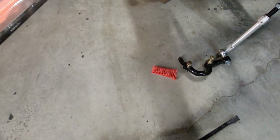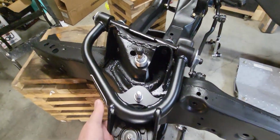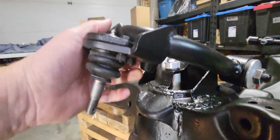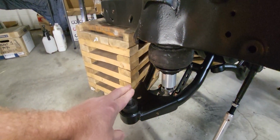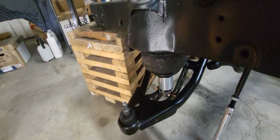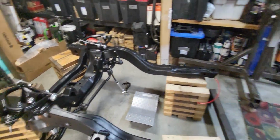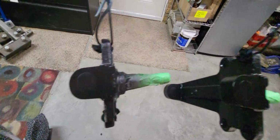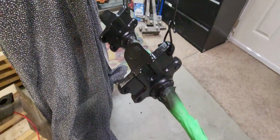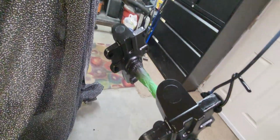And the reason for that is the suspension is all the way down. There's no tension on it. So if I had lifted this guy up here and put a 2x4 just between the bump stop and the bump stop, that would have put tension on the suspension and caused that thing to actually spring apart. So there's a pro tip for you. Your spindle may be loose. Took me a few whacks with the hammer, but I didn't beat it up too bad at all, even. I can't even tell which one. Oh yeah, if you look this way, you can see the little deformation in the metal, but that's the way she goes.